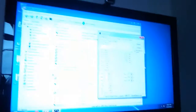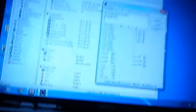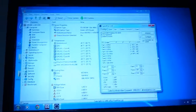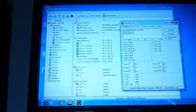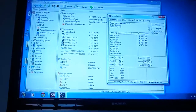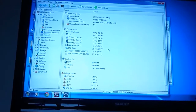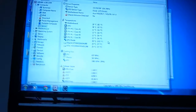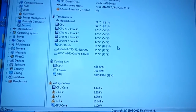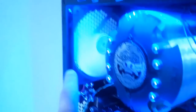I'm just going to go over to the screen now because we are in Windows. I've got this set up in the BIOS to do this automatically, but I'm going to show you that you can actually control the speed of these fans manually in Windows. I've got this program up and it basically tells you the speed of the CPU fan and the chassis fan. The chassis fan is actually this fan here — that's the actual speed it's sensing.